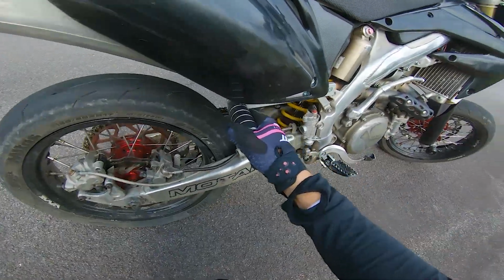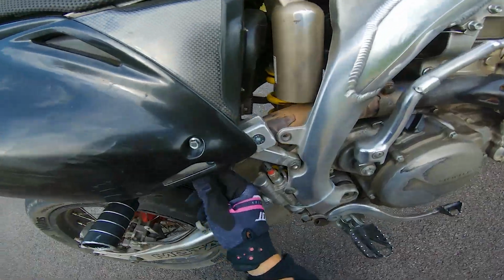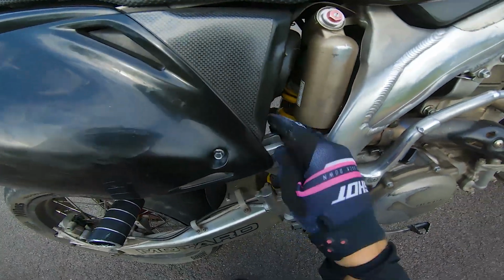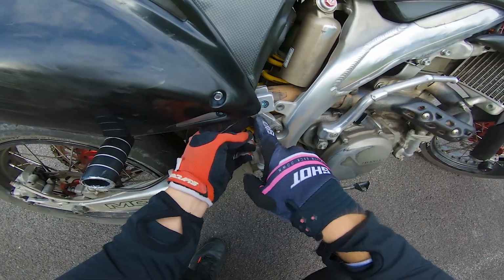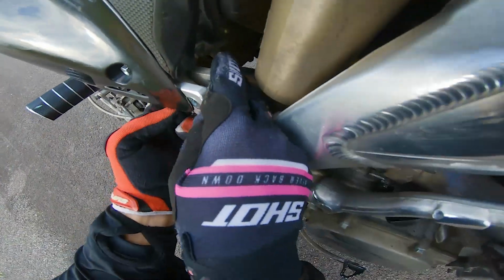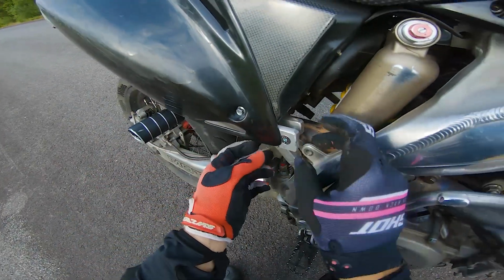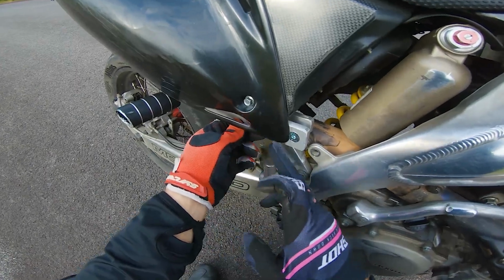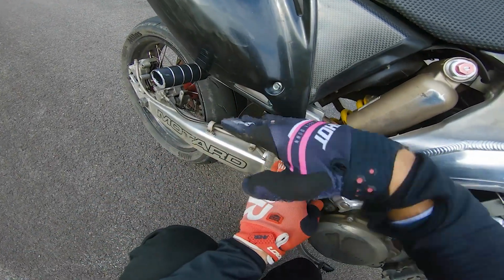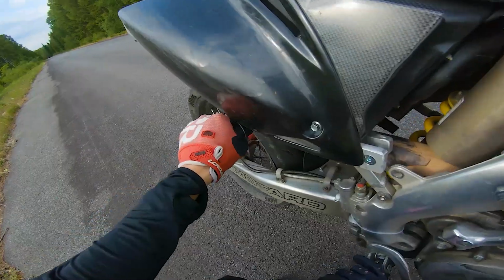And if we just look up here, it's my latest mod. It's a BMX peg and 2 aluminum brackets or rods or whatever, I don't know the word. I didn't want to drill a hole and make a weak point in my subframe, so I kind of clamped around it. What you don't see here is that these 2 aluminum parts have grooves milled into them, so they can't move up and down. They are really clamped onto the subframe, so this is really stable to stand on.